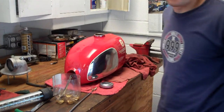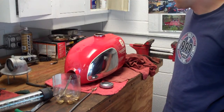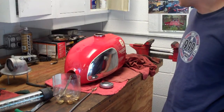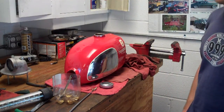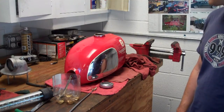Now, if the tank is too far gone, you're probably going to have to use a sealer, or acid etch and sealer like Kreem, or I think POR-15 has one. But this one only has light surface rust and I can definitely deal with it just with the method I showed you. So thanks for watching — visit my site, HowToMotorcycleRepair.com.